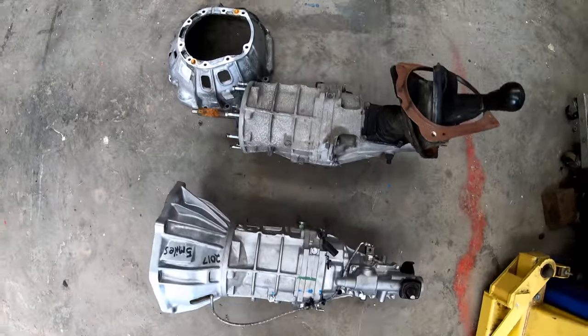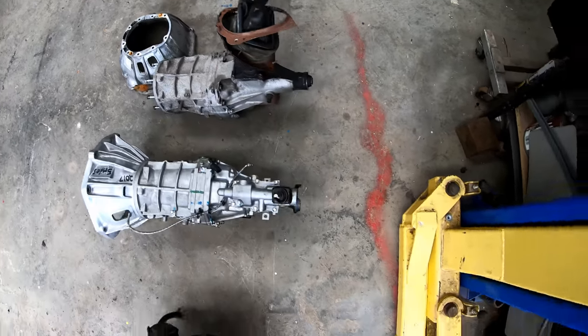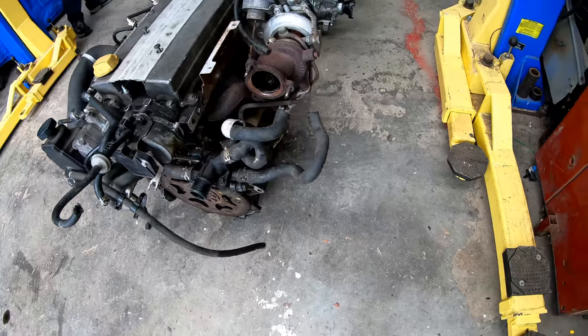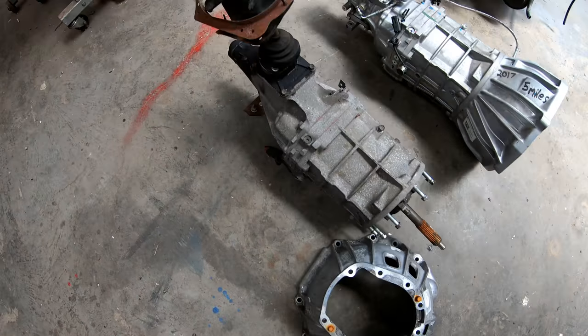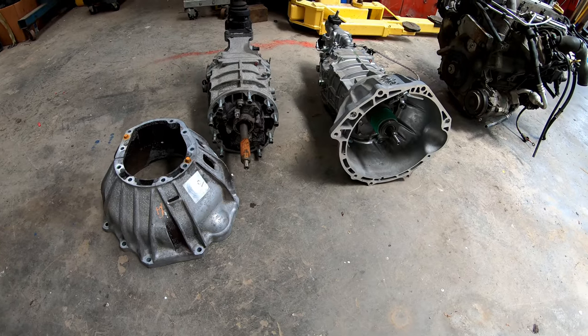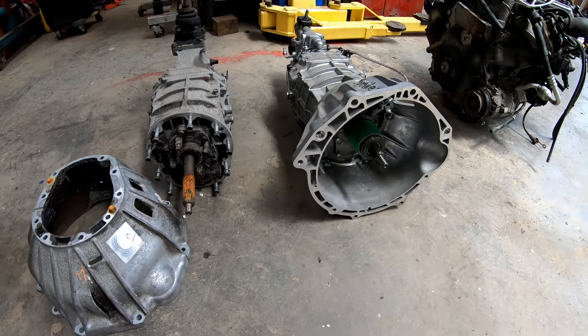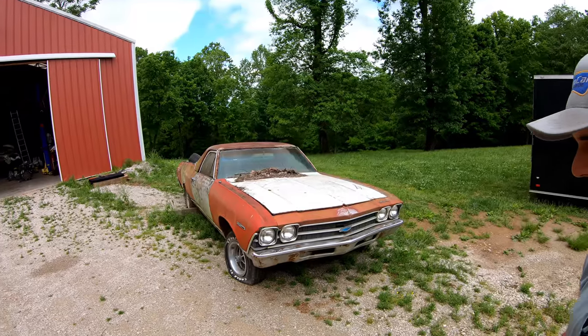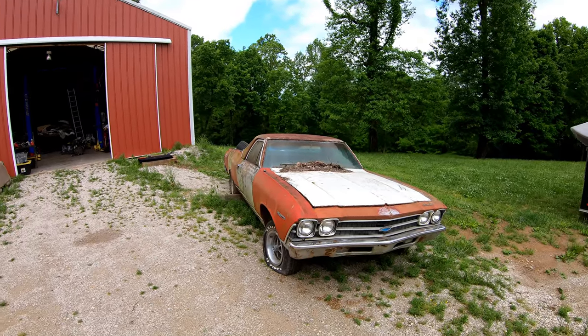The bell housing to mate that transmission to the Ecotec has to have an Ecotec bolt pattern, and to get a rear-wheel drive Ecotec bolt pattern, we had to use a Solstice transmission bell housing. So Solstice bell housing, but the Ecotec out of the Saab isn't necessarily anything special that would prevent other folks from doing this with something out of a Cobalt, right?